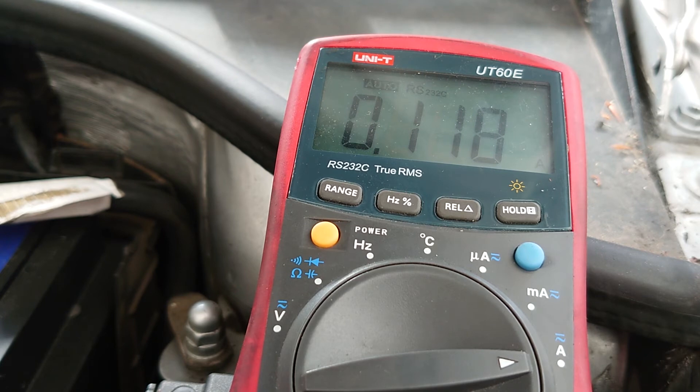So we're fairly happy that we've got an issue with the alarm siren. An interesting thing to note is that it makes the indicators flash but it doesn't actually sound the siren, so potentially this was going off in the middle of the night and no one noticed. This is going to need a new alarm siren. Hopefully you found this pretty informative — thanks for watching.